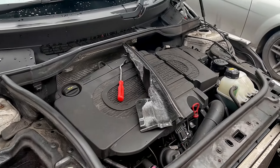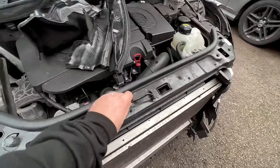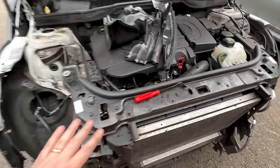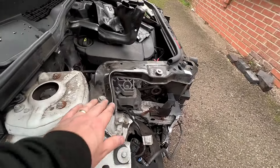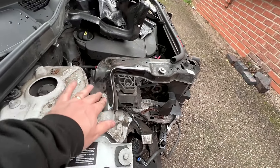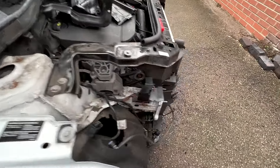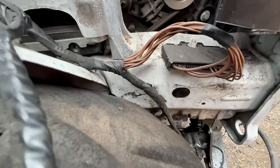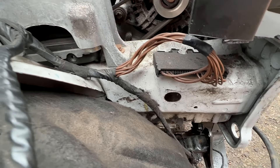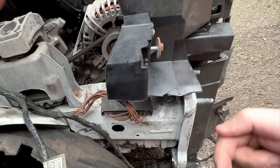Let's crack on. I'm going to pop all these panels out and I'll be back with you. We've removed the panels, as you can see on top there. Slam bar's next. Now I've removed the panels, you can see just how far back that slam panel's been pushed — it's pushed right back and it's twisted the metal. And looking down at the frame leg down here, you can see it's quite kinked at the top there.